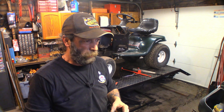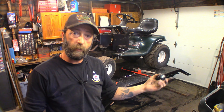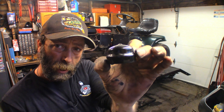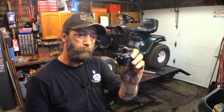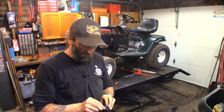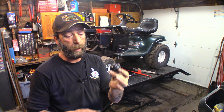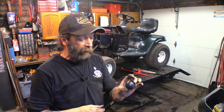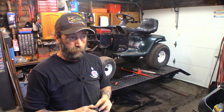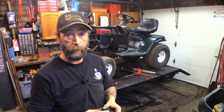I was just about to pull this outside and I remembered I had to put a tube in the other tire. Might as well do it now — that way I don't have to bring an air pig out there and reinflate the tire to get it back in the shop. This vinyl cap is supposed to be squishy, but this one was really on there. Quick tip: if you've got to get these off and they're hard because they've hardened up, just hit it with a heat gun — or the wife's hair dryer. Don't tell her. Make sure you wipe it off before you put it back in the bathroom. Hair dryer gets them off.